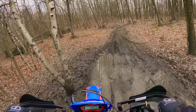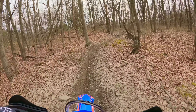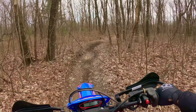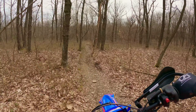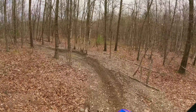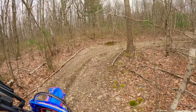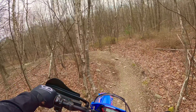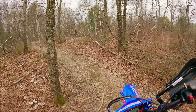It just feels a lot more responsive since they really changed a lot of the valving. What we asked for was a setup that was better for hard enduro more than motocross. So if I come off something big, yes, I'm going to probably bottom things out — it gets a lot more plush when you set it up for this. But a lot of the time what you're doing is asking that front end to absorb a heck of a force, and that's really where plush suspension starts to save things — save your wrists, your back, all that stuff. We had them respring it for my weight, currently around 240-250 pounds with all my riding gear on — a bigger dude, 6'1", 6'2". Having it resprung and set up correctly right out of the gate was just a complete game changer.